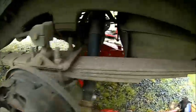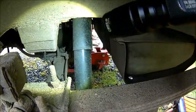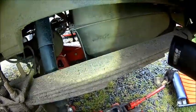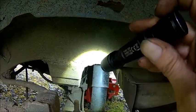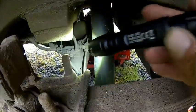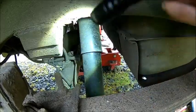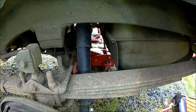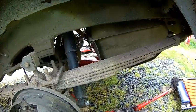We need to put a new brake line in, which is down here. The coupler is here. I replaced that brake line a while ago and I can't get it out from the axle, so I'll just put it next to it. We need to make that piece to the other side completely new — there's no point keeping the old one. When I did that, I just cut the other side and put a new fitting on. You can still see the old one here. I can't get it off — that screw where the torch is pointing is screwed into the axle and you can't get it out. It's the vent of the axle, so if you break it off you've got a problem. So we leave it as is and just tie it down with the other one.